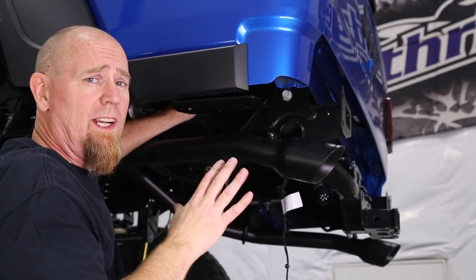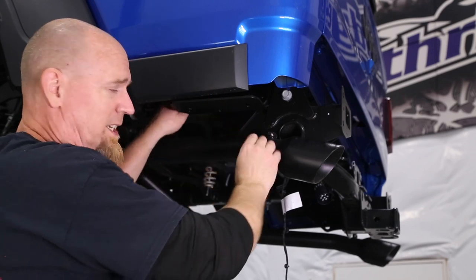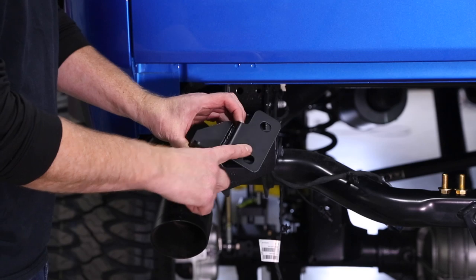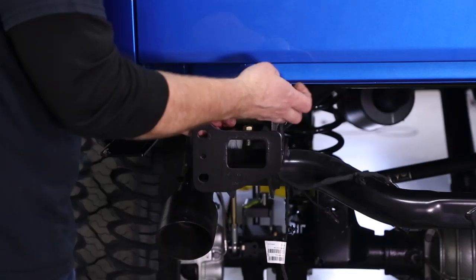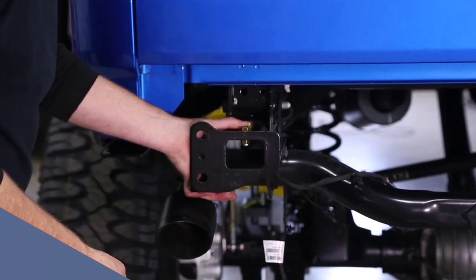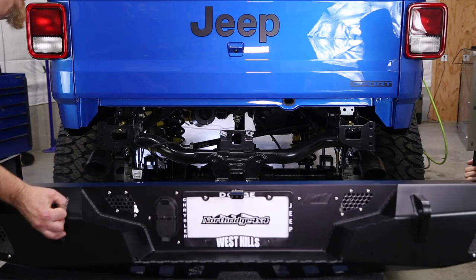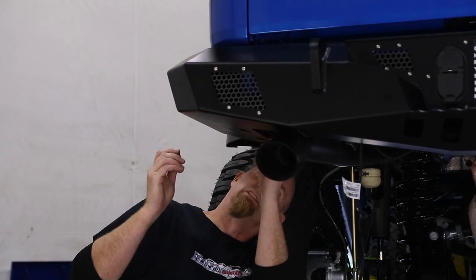We're going to put Loctite on the bolts but not tighten everything up yet, because we want to get the rear bumper up into place with all the hardware and get everything adjusted before tightening. Motobilt includes stiffening brackets — the top holes go right in where the tow hook was, and the side holes go into the back of the frame support. Now we're finally ready to put that bumper in place. A really long extension is helpful to get to the nuts at the back of the bumper past the side brackets. Then bolt the side brackets and the bumper together.